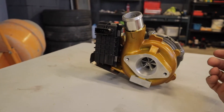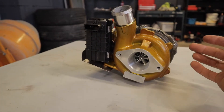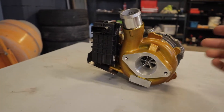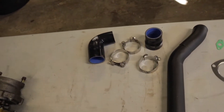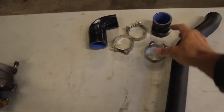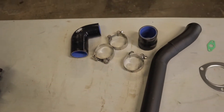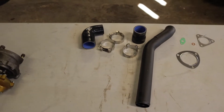At the same time I'm going to be showing you how to replace the turbo if you want to replace it, or if your turbo blows, I'm going to be going through the process and the steps associated with that. I'm also going to be upgrading the hot side of my intercooler piping, which is just replacing it with this pipe and a couple of silicon couplers. It's good to do this at the same time because you've got to remove this anyway to remove the turbo.